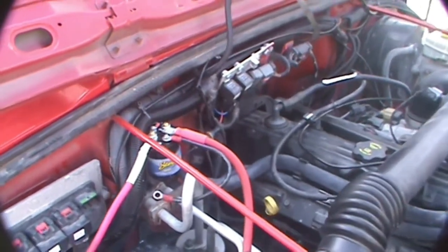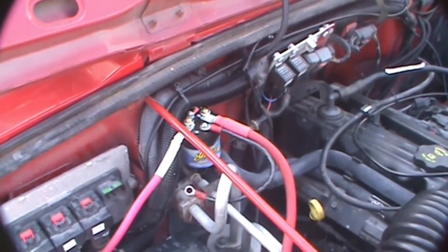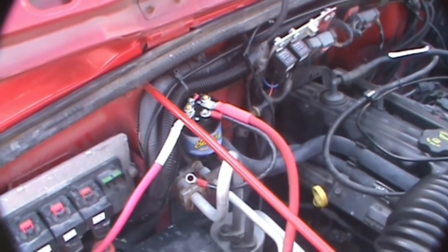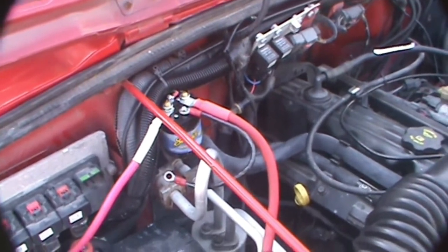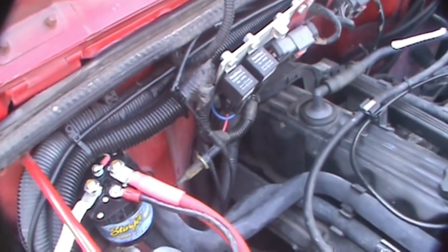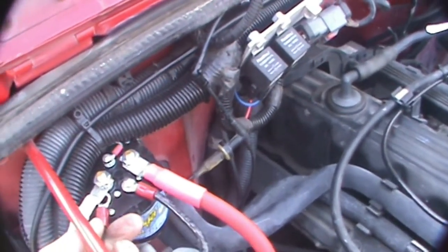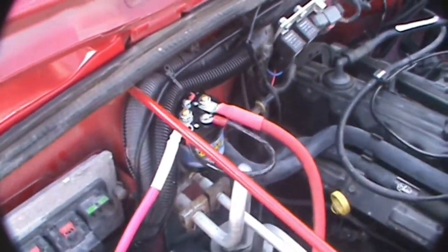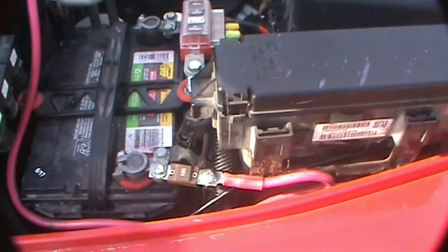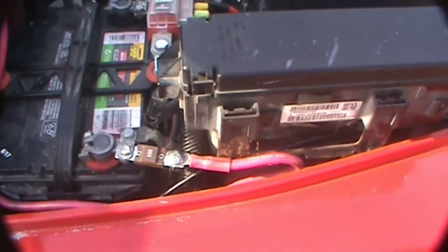This is to test out my newly wired winch on my Jeep. I just finished wiring it up. There's a disconnect solenoid which will be connected to a switch inside the cab, but for the moment it's temporary. There's a 500 amp fuse here — it's a floating connection I don't really care for.